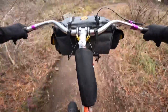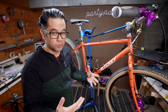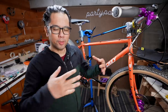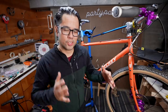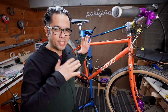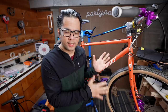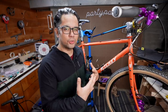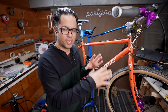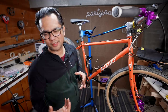Man, lots of control with these handlebars. Just finished up from the ride — very short ride, just to feel the bike out, test it, make sure it fits. What are my thoughts so far? I think it's a really different bike from what you see out there in the market. Most gravel bikes still try to emulate road and cross racing bikes — tuck, short chainstays. This definitely goes in the opposite direction, going longer in the rear. That adds a ton of stability going down the singletrack; even without a super slack front end it still felt really stable and confident. The front end — even though it was slightly on the higher trail side — didn't feel too floppy. For me this feels like neutral but high front-end handling: a good all-rounder, not super sloppy on pavement but with added stability when things get chunky.